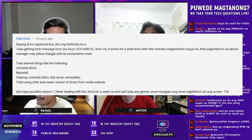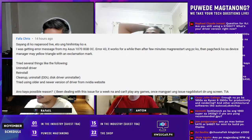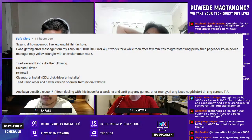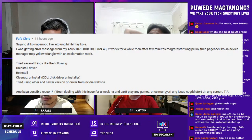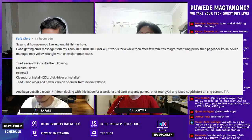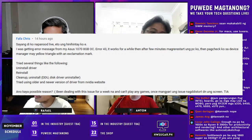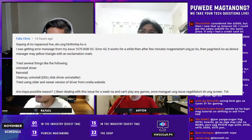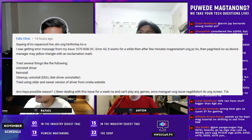Next question from Fafa Chris. He actually posted it on our YouTube on our last episode because he didn't catch the last one live. He has an Asus 1070 graphics card. He says: I was getting error message from my Asus 1070 8GB, error 43. It works for a while, then after a few minutes my PC restarts. Then when I check the device manager, there's a yellow triangle with an exclamation mark. He's tried uninstalling the driver, reinstalling, cleaning up, DDU, an older version of the driver, but it still doesn't work.